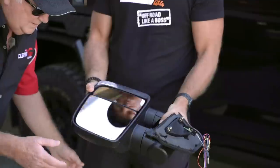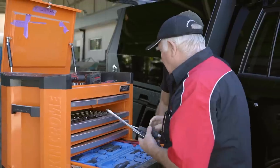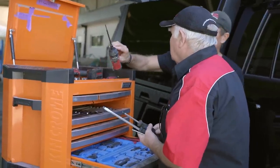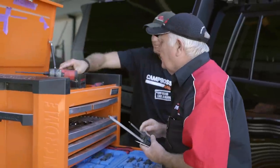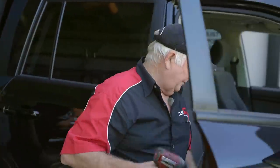The indicator is Category 6 and it comes with a built-in clearance light if you want to hook it up. See the puddle light — if your car's got a puddle light in it, you can hook that up as well. Let's get them on and see how they roll. Within a set of Clearview, all you need to remove the trim is a little short flat screwdriver, a Phillips head, and a 10mm socket. To get your door trim off, we just give it a pop out with a screwdriver.